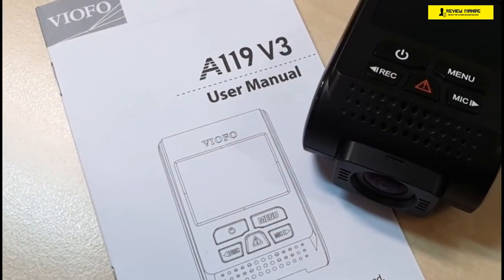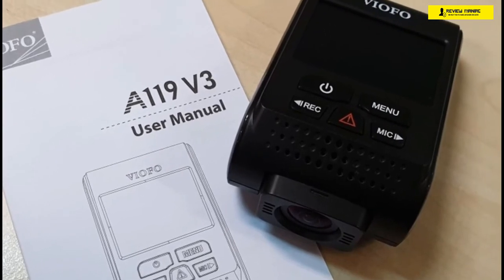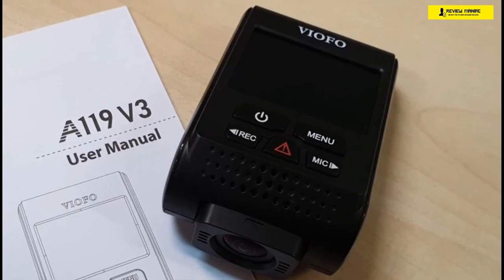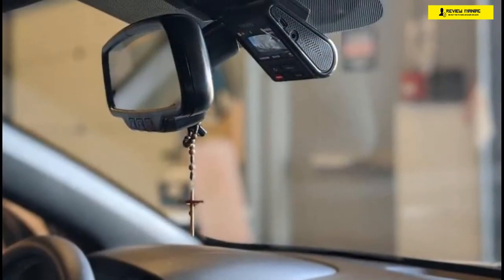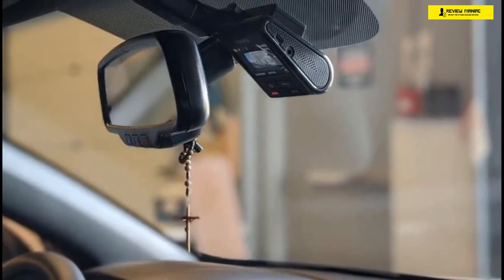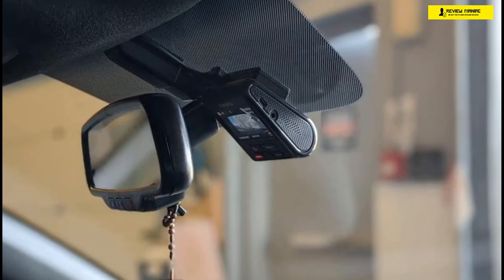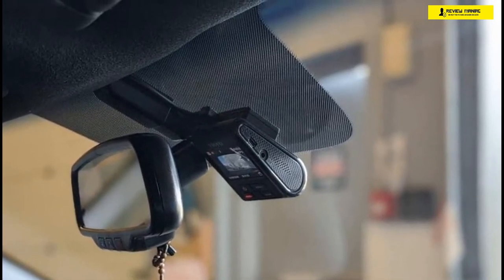Most users prefer to run this camera at 2560 by 1440, or 1440p resolution though, which is a 16:9 format and the same width but a bit less tall. Lower resolutions are also supported, including 1080p at 60 frames per second (FPS) and 720p at up to 120 FPS. However, we recommend setting the resolution to 1440p at maximum bitrate to achieve the best video quality.